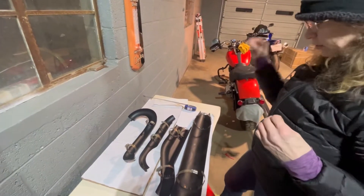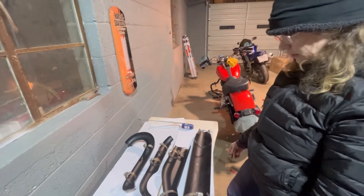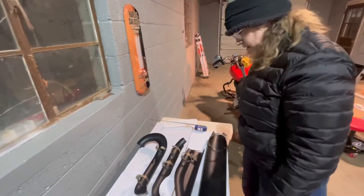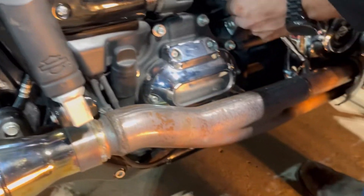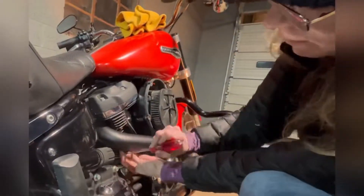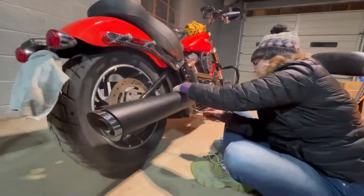Should we start with the smaller one and work our way back? It doesn't really matter — you can put the two single head pipes on first or the muffler cover on first. Either way, the centerpiece goes on last because it actually overlaps both of the front two and the muffler. We decided to start in the front, then do the rear exhaust pipe, then the centerpiece. Attaching them is easy as long as you attach the worm drive clamps to the inside of the heat shields before wrapping them to the exhaust pipe.